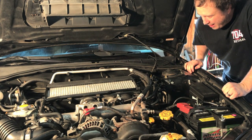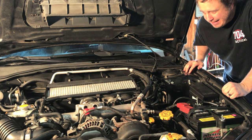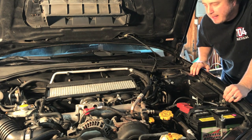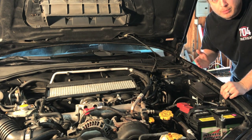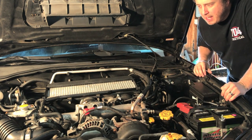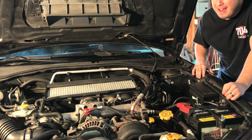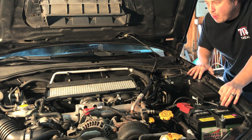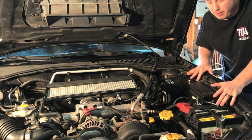We're back working on the Baja again because I still have not figured out this rough idle issue. I've been doing a lot of research and I think I might have figured it out. Every time the car starts cold, no problem — no rough idle, starts around 1500 RPMs. It's only once it gets warmed up and you start doing things at idle that you feel it, stalling out when coming to a stop or a stop on an incline. I don't want to do compression tests or leak-down just yet, hoping the motor doesn't have valve clearance issues. I've done multiple smoke tests and leak checks — everything's looking good, the car boosts great.